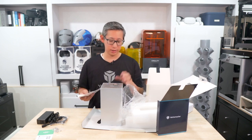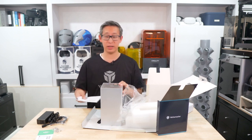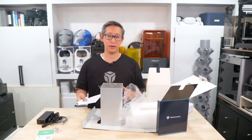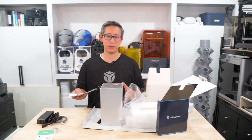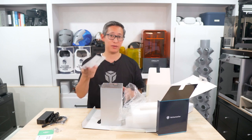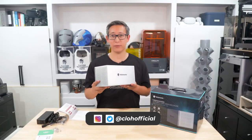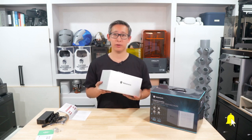After reading the instructions, this external enclosure is shipped and configured to operate in normal mode, meaning each hard drive when installed will operate as an individual hard drive rather than being set up for RAID. If you decide to change that configuration and hot swap the hard drives, it will interrupt the operation of the other drives — so you need to be sure how you're setting this up beforehand. Like most hot swappable devices, make sure you stop the service in task manager before swapping any drives out.